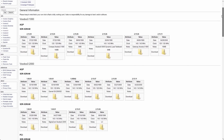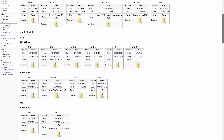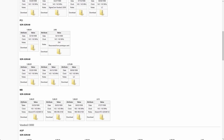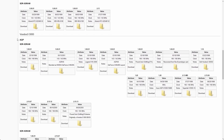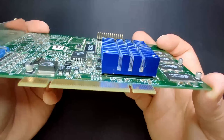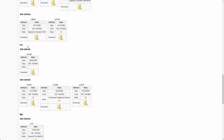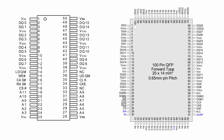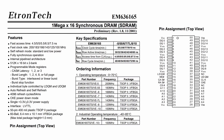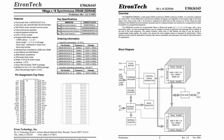Unlike the flashing utility, finding the correct BIOS file is more challenging. We need to know exactly what model we have to select the correct file. There are different BIOS versions for different Voodoo 3 models. We can already eliminate BIOSes for AGP cards because our model has a PCI interface. We also need to know what type of memory this card has — Voodoo 3s were available with SDRAM and SGRAM. Visually, you can distinguish them by the chip package: chips with pins on all 4 sides are likely SGRAM, while chips with pins on 2 sides only are most likely SDRAM. To be certain, you can always look up a datasheet for the memory.